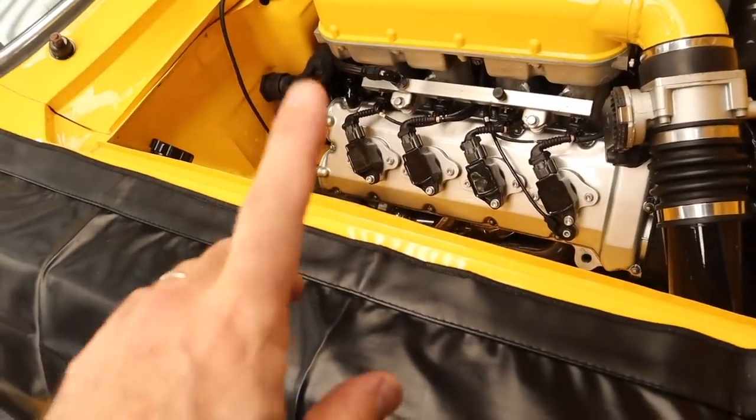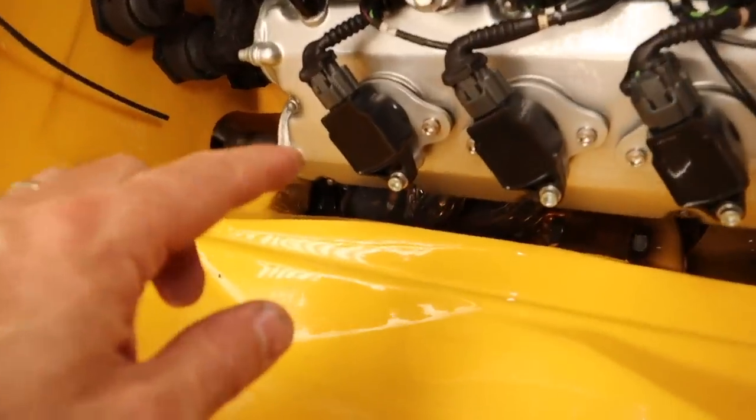The next thing that was not smooth sailing last week was right down in the depths here. You can see the V-band clamp is rubbing on the side of the body of the car. I thought I left enough room when I first made it, but then there's a reinforcing plate that spaced things out a bit more, and there's just less space than I thought — I did it without the clamps on. That clamp is currently sitting straight hard onto the side of the car.